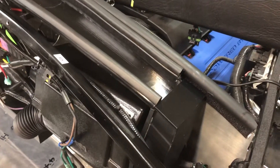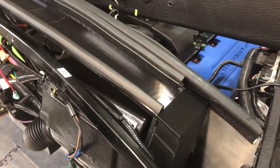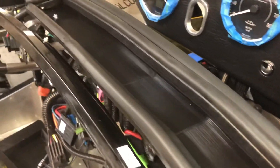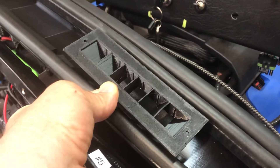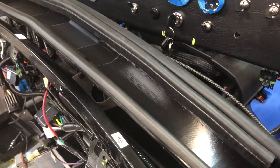I've got a two-piece plenum that just goes over the round outlet of the heater core, and then I've got a plenum or trough that's open — it stays on the chassis side. I've got seals that run along here that coordinate with the bulb seal on the front of the dash, to get the air cross-car. Then I made a little set of vanes that go on the body side — the whole spacing is the same — that go with the grilles on the outside.